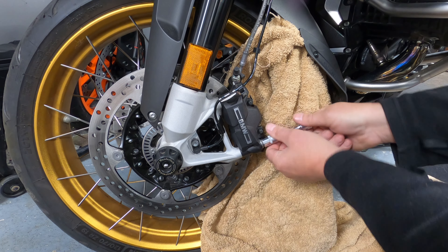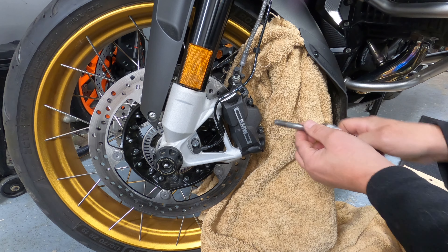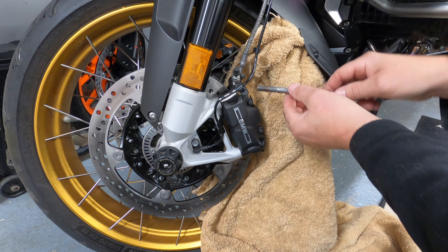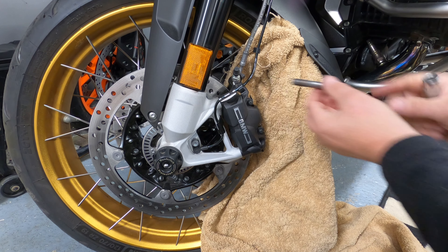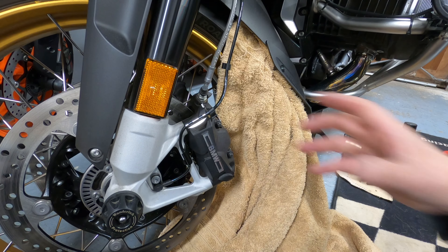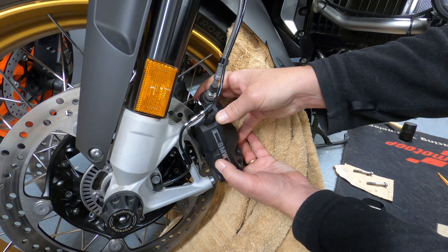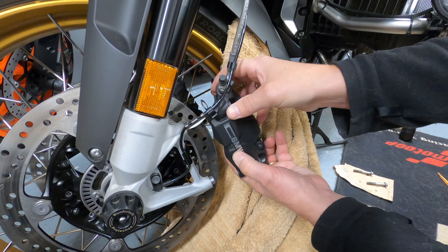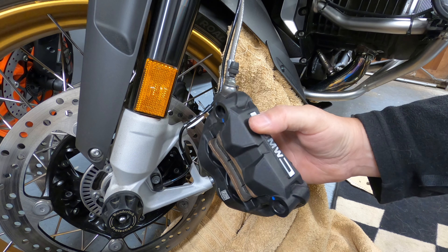On the other side you've got a retaining E-clip, so if you undo the screws fully now that E-clip is going to potentially fly off and you might never find it again. With your 6mm socket, just pop it over the top and undo it about an eighth of a turn just to loosen it - you don't want to undo it fully because that circlip will pop off. Then with the towel still in place to avoid accidental damage, take the bolts off. Lay them out on cardboard and label them so you know which goes back into which calliper hole. Then remove the calliper from the brake disc - just pull it, a little bit of a twist, and it comes away. As simple as that.